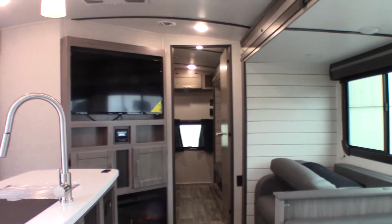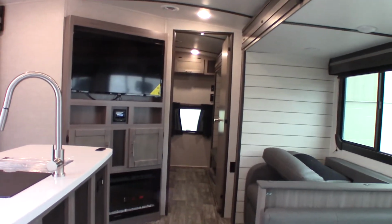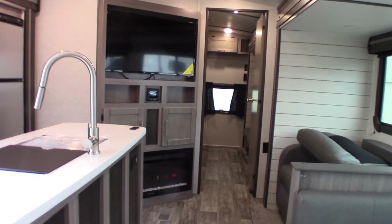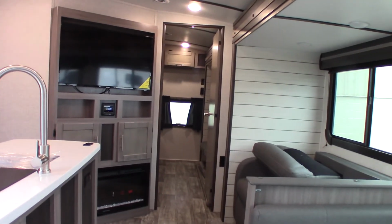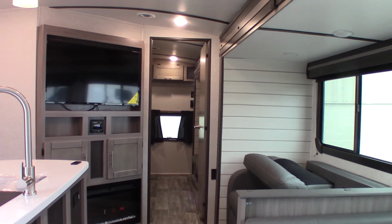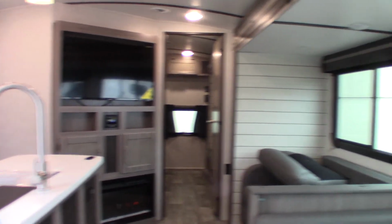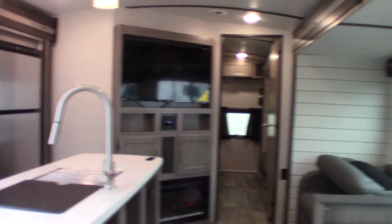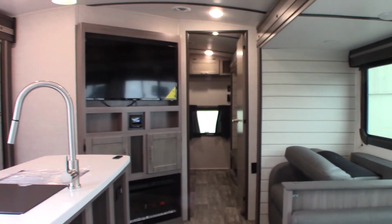Okay. First I want to thank you for purchasing your trailer here from National RV Detroit. And second of all, I want to remind you what I told you earlier about inspecting the seals on your trailer. Any place you see caulk from the factory, on the sides and on the roof, especially the roof, pay close attention to it. Corner areas always seem to be where, when we have some separation, it usually happens. That's not just for this trailer, it's for every trailer ever built.